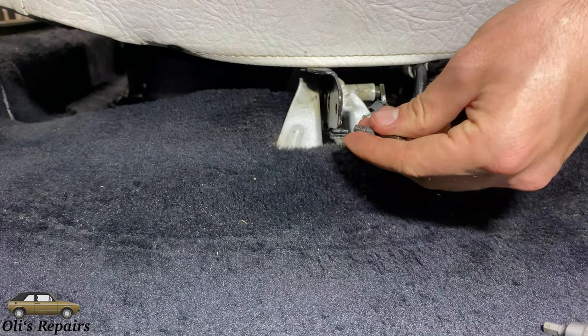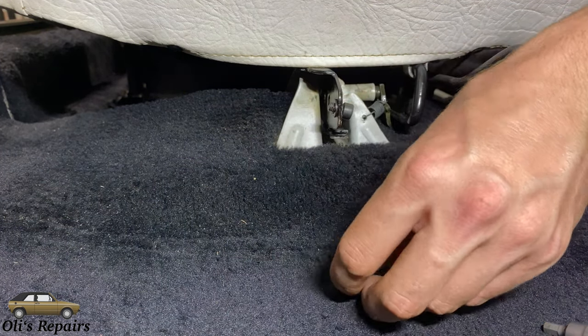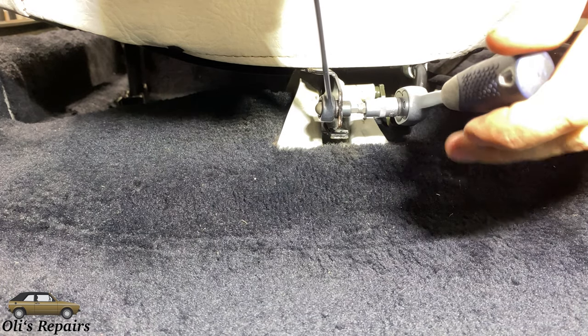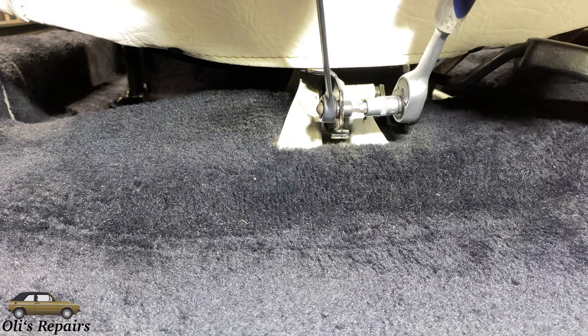Next, take the spring — you can slide this larger end over the vehicle portion, and then stretch the other end into this little hole in the pin. There you can see it's attached. Next, grab your retaining bolt and nut, slide it through the hole, slide on your locking washer, and then finally put on the acorn nut. There's no torque spec listed for this, but it also doesn't need to be extremely tight — it's just a retaining nut going into a little piece of metal, so just snug it down.